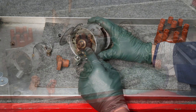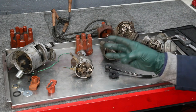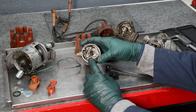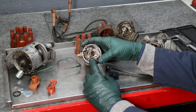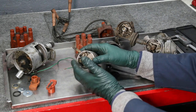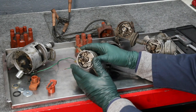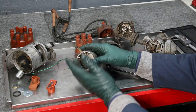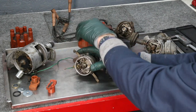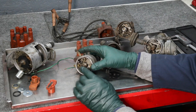If you're pondering whether or not you want to make this conversion on your old Mercedes, I want to encourage you. There are three really good reasons. Number one: you get rid of the troublesome points — no more constantly adjusting points and dwell, and no problems with points getting corroded over time. Number two is a really good one for purists: you're not really modifying the distributor in any way from the original. If you have to go back to original for a car show, you can put the points back on — you have to use the original cap and rotor to make this work anyway, so there's nothing you're doing that would hurt the originality of the car.